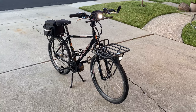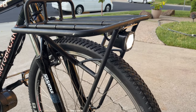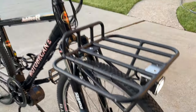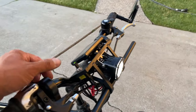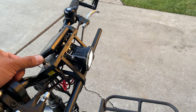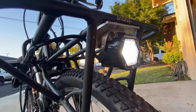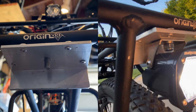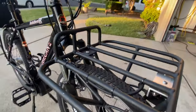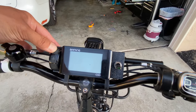So this is my bike with the headlights installed. I have a lower one that's kind of pointed down low, acting like a fog light. I really hate blinding people on the trail so I try to keep it as low as possible. Then I have one mounted up high which is my high beam — I can turn it on and off with this switch — and it's pointed more upright so it'll light a farther distance away.